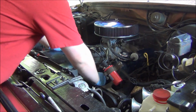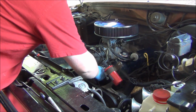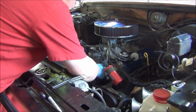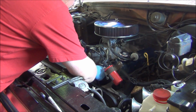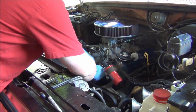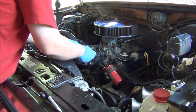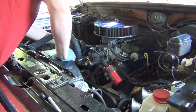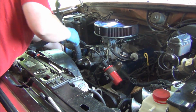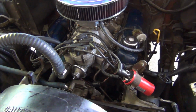I double check this. Okay. I'll have it kind of snug so that I can move it around. I actually want to disconnect your vacuum line before you run it. And if you happen to unplug a spark plug, feel free to plug that guy back in so that you don't have a misfire. Holy shit, it turned on first turn of the key.